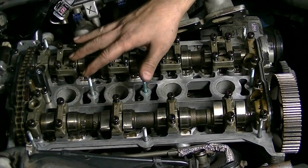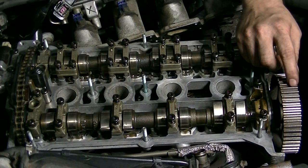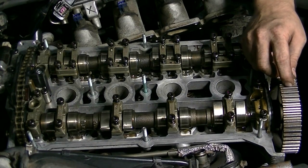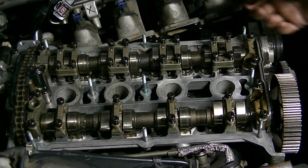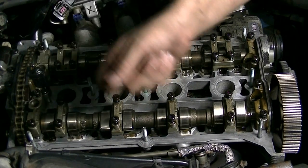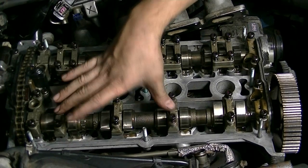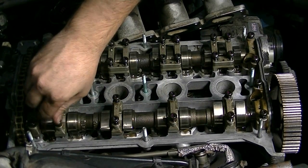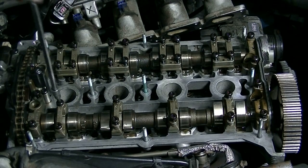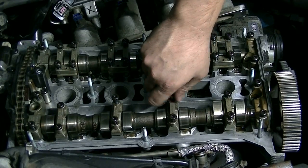Before I put this on the cylinder head, I ended up moving the camshafts. There is a notch on the camshaft pulley — we need to get that to face up or as close to up as possible, because that's where top dead center is. I had someone hold the camshaft chain tensioner while I rotated the camshafts together. The torque spec for the camshaft bearing cap bolts is 8 foot-pounds. You want to tighten these a little bit at a time, jumping between them so it goes evenly.